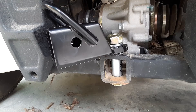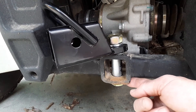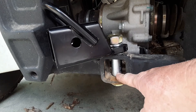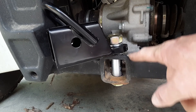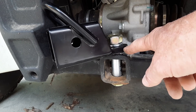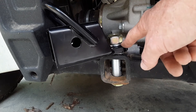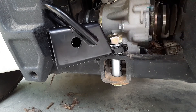This is just a loose fit of everything put together so you can see. I've got the four-inch bolt coming through the bottom here with the washer. Then I've got the sleeve in here of the three-quarter inch EMT conduit. Underneath, between the frame and the adapter, I have the washer that came with the kit. Then on top of that I have the lock washer that came with the kit, and then the new nut. And I'm going to go ahead and tighten everything all together.